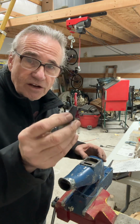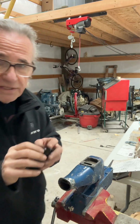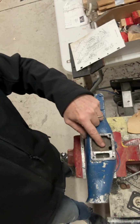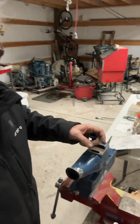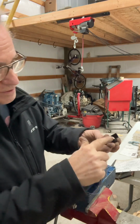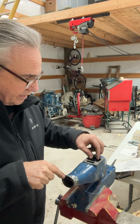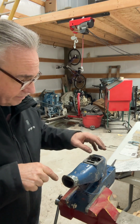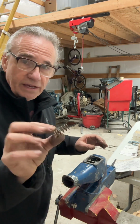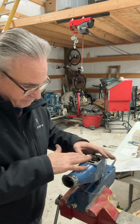This little plastic piece is called a diverter valve, or it's just a diverter. There is a hole inside the manifold, right up in this corner, right down here. And we're going to position this such that this little area right here covers that hole. And most likely this'll nestle there in its correct location. That is going to be followed by another fairly stiff spring that sits down inside of that diverter.